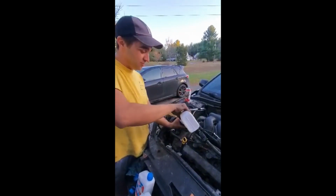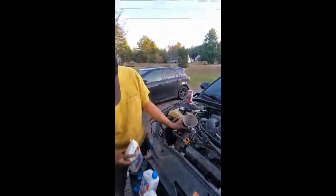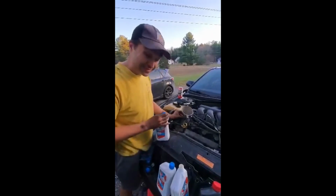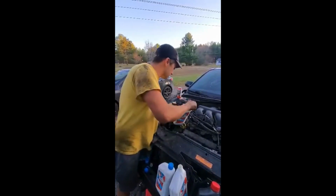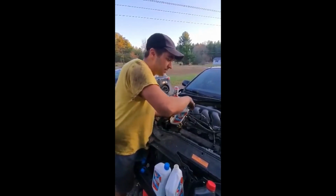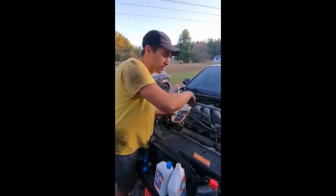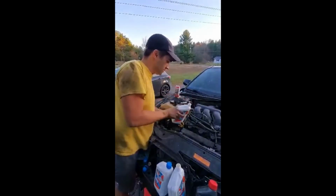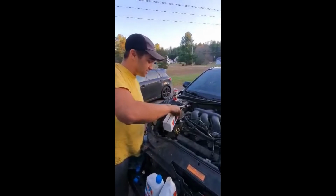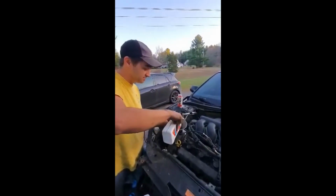But we got that mostly fixed. Got 2 bolts holding it on. So right now we are putting 5.5 quarts of oil in this bad boy. Seems like a lot, but it's all good. This is the #1 thing we need. We don't have the coolant hooked up yet, but we're not going to bring it up to operating temperature, so it should be fine. And boys, we're about to start this thing open header, so next video will be the big startup. It's like dumping out right under there.